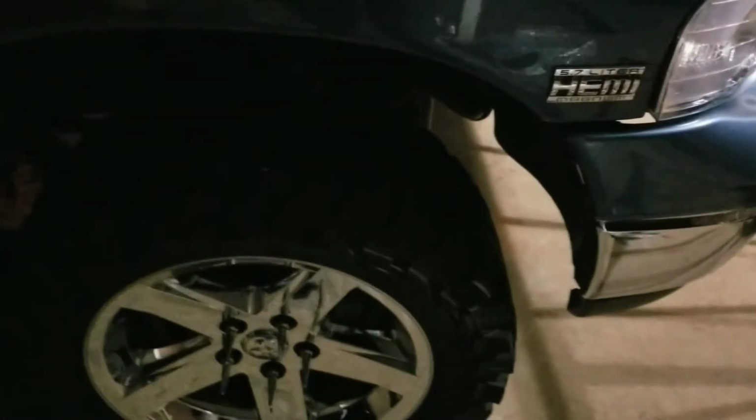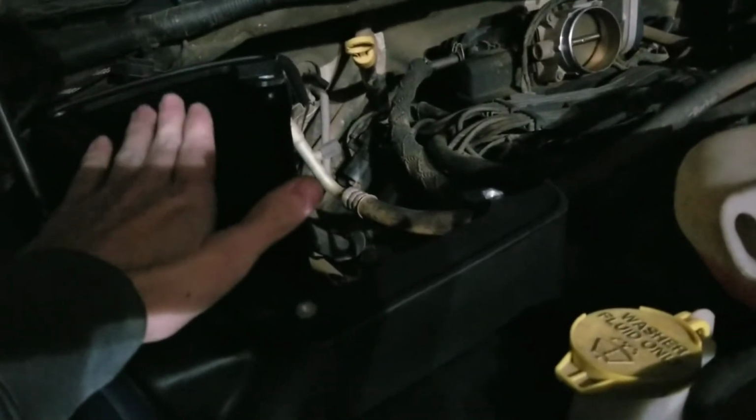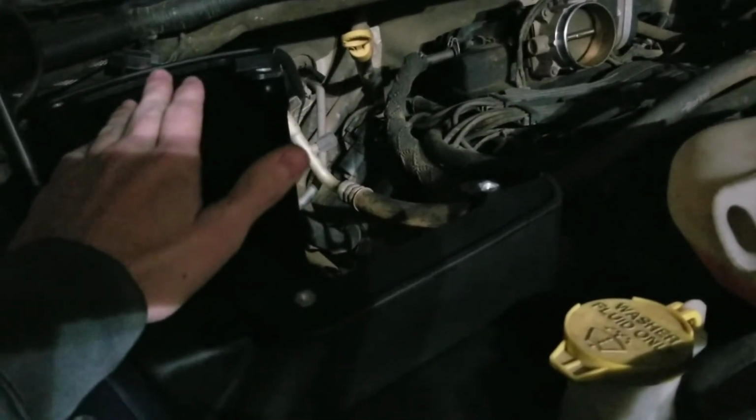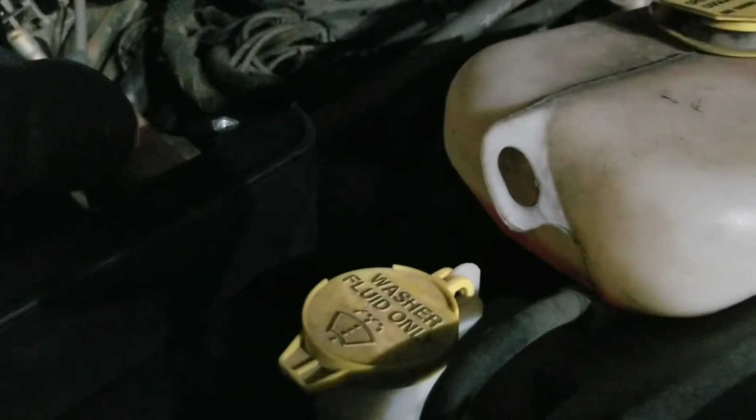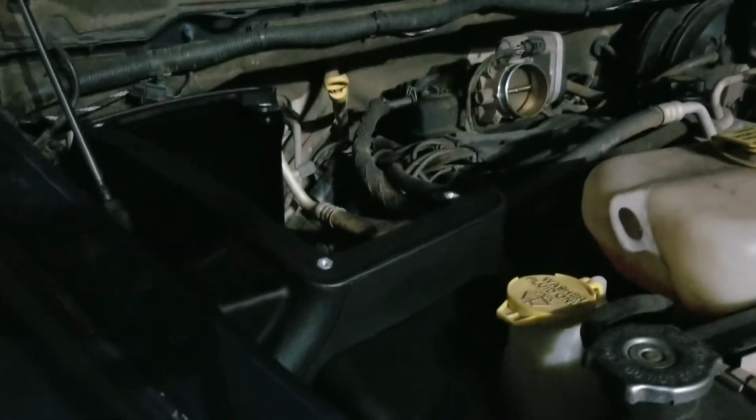That bolt to the fender liner, and I've put the fender liner back. You have to take the fender liner, but you don't have to take it all the way out like what they say in the instructions. I didn't, anyways. I just took all of the bolts out, and then pulled the fender liner down and let it rest on the wheel. And now moving on, I think the next thing is finishing up the air box assembly for the most part. So the filter adapter here, and then possibly the lid, but we'll see.